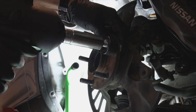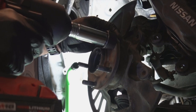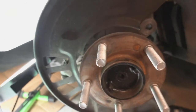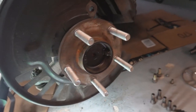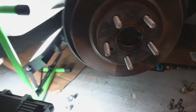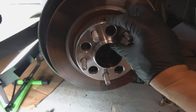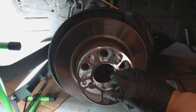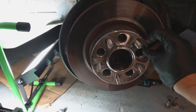That's pretty much it — it was really quick. The longest part is just taking the brakes apart. Throwing the rotor back on now. Here's the 12mm hub-centric spacer — see what it's going to look like. It's 12mm so it doesn't bring the wheel out much, but now I can work with up to 20 millimeters and do all kinds of things without having to worry about the wheel falling off.